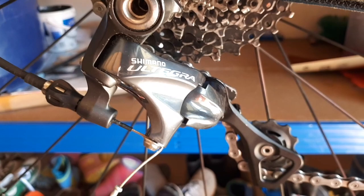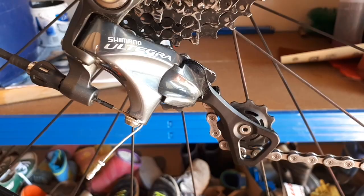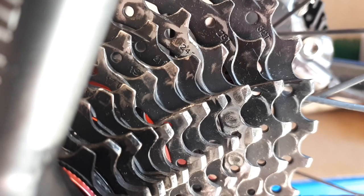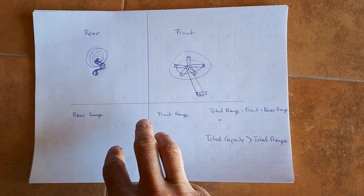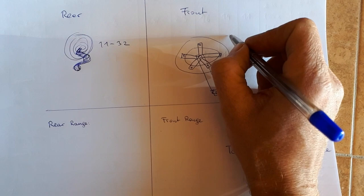When looking at possible ranges and cassette sizes, one factor is the largest sprocket and the other is the capacity. I'll explain capacity briefly. I'm using a Sunrace 11-to-32 cassette, and on the front a Rotor crank with SRAM chainrings that are completely compatible with Shimano chainrings — 50 on the large ring and 34 on the small ring. I'll show how to calculate the range separately for rear and front, then add them together.